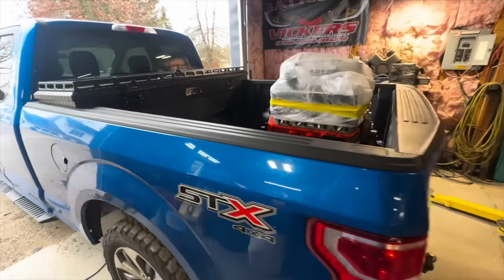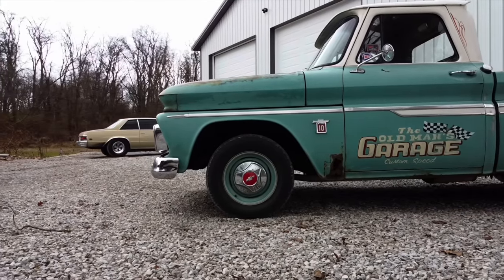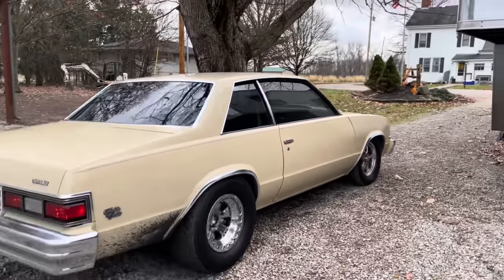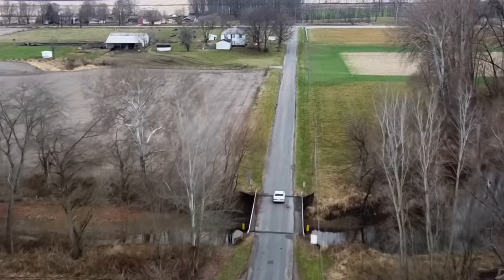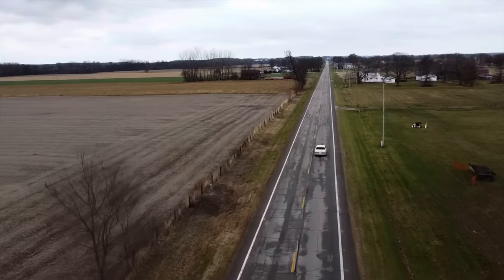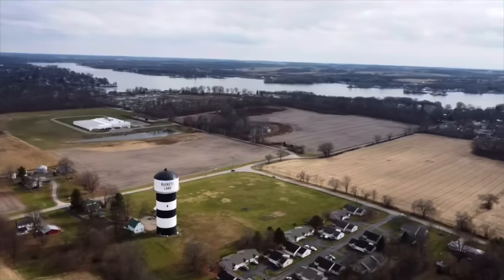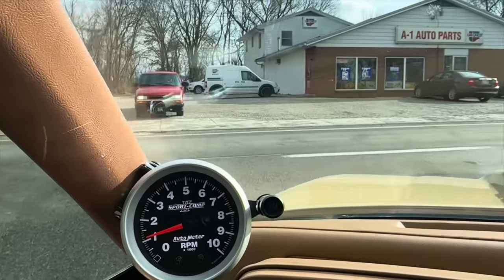Unfortunately, since we're pressed for time, Tim didn't get an opportunity to drive the 427 in my Nova. Since the 421 in my Malibu and the 427 out of my Nova are so similar, I decided to take Tim for a little ride so he can get some idea as to what these engines run like and how they cruise. Both the 427 Tim won and the 421 in my Malibu have Trickflow 230 heads, Trickflow R intakes, Isky hydraulic roller camshafts with Johnson Isky lifters, ATM E85 carburetors, Melling timing chain sets, shark tooth billet aluminum oil pumps, SCAT rotating assemblies with J&E pistons, World Products Motown 2 blocks, and ATI 8-inch dampeners. The main differences are the stroke of the crankshaft and the compression ratio, so our little drive down to Buckeye Lake to see Mark at A1 should give Tim a really good idea as to what to expect out of his engine.